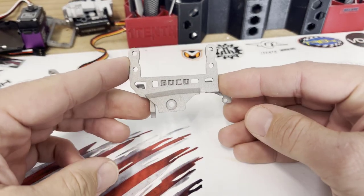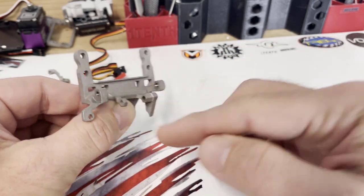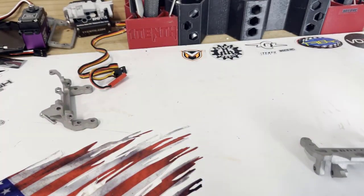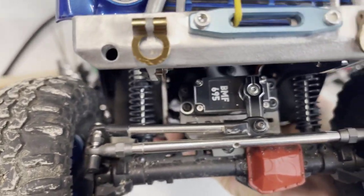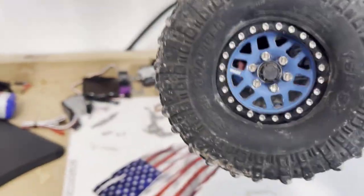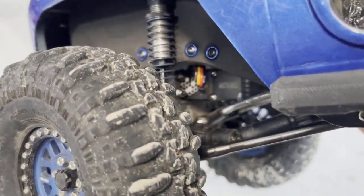The tall boy was designed for as straightforward of an install as you can get. The servo sits up higher, so you have more clearance for the links if you want to center triangulate, and you still have the raised uppers. I'll show you on the rig I have it on. The tall boy is a pretty straightforward install — drag link, tie rod, all that stuff. No special bends, no special spacing needed, and you get plenty of room in the back to clear links without having to do the spaghetti noodle style links.